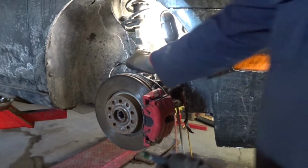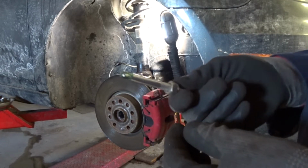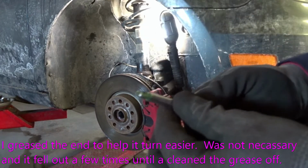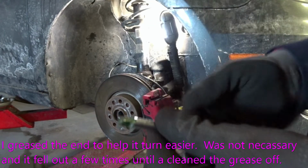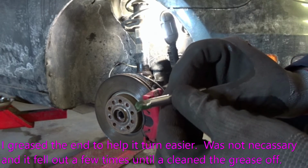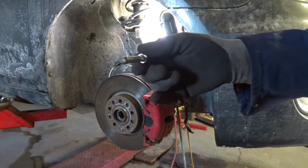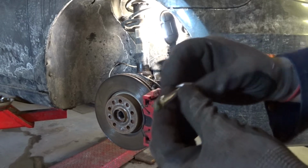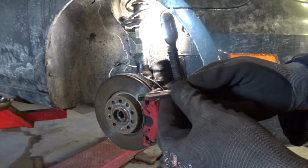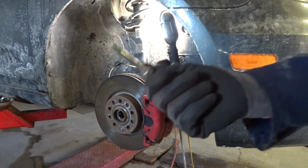All right, to release the strut from the knuckle, there's a special tool. I don't have it, so I've made one. This is a broken 1/4 inch drive extension. I've ground 2 flat areas and slightly rounded them off, and then made 2 small flats on the side which will hold it open, and then I've hammered on a nut. I may have to weld this, I'm not sure. Kind of thinking it probably will, but we'll see. I've got it down onto the knurl, so we're going to slide that into the gap. There's a place to do this, and this is a 9/16 nut. I'm going to put in a deep socket, and then hopefully we're going to turn it 90 degrees. I've marked it so that I can see when I've got that turn. But anyway, here's the tool and how to make a tool in case you want to do the same.